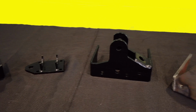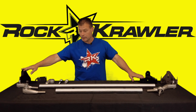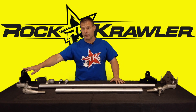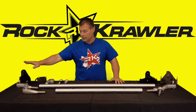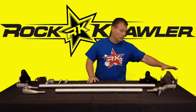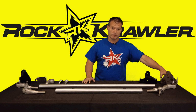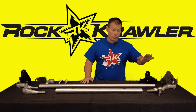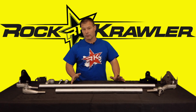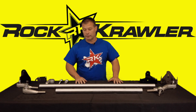For JL, JT, and JK, we offer 2 brackets that are designed to go with our drag link flips to relocate the track bar to keep your steering geometry correct. These are bolt-in/weld-in brackets. For JK, JKU, we also offer a full replacement bracket because we all know they just rip right off anyway. That's why these also require welding, because the factory brackets are really not strong enough to support the extra leverage being put on them when you're doing a drag link flip.